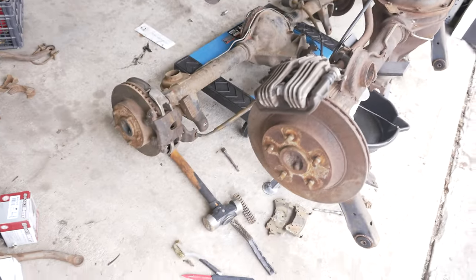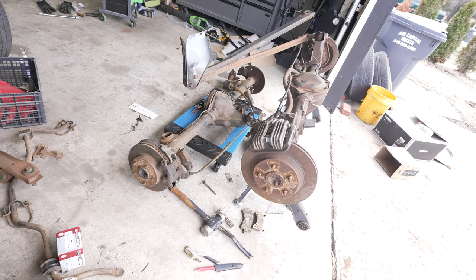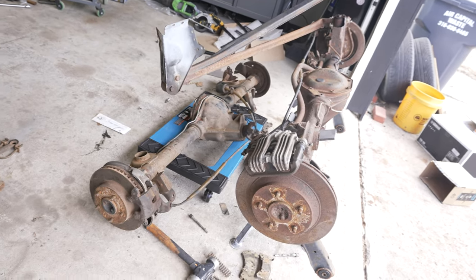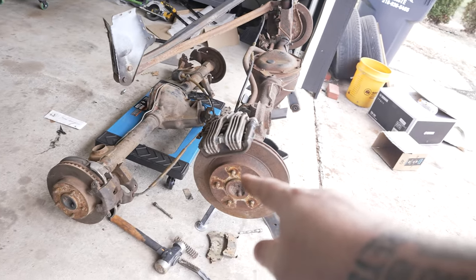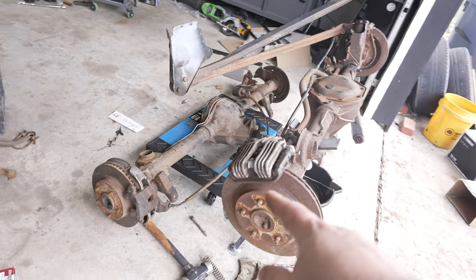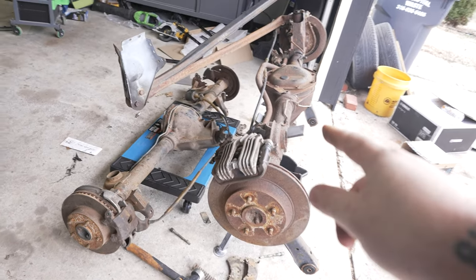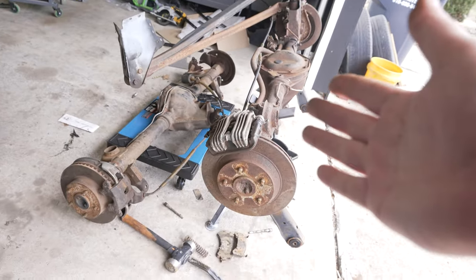Forgive me for my lack of knowledge — I don't know a ton about these, but from what I've learned, there wasn't anything I could find on YouTube that would tell me how to differentiate. I was a total noob when it came to differentials, but luckily there are guys in the forums that were helping me and I was able to figure it out. To sum it up: 82 to 88, then 89 and up. I'm not sure about the 90, 91, 92s — but I don't think they made the nine bolts after 1989. 89 was the last year for the nine bolt, and apparently that's the most desirable year.